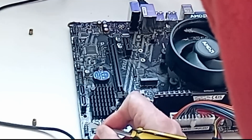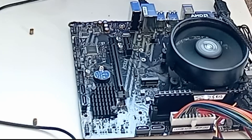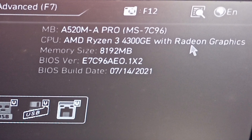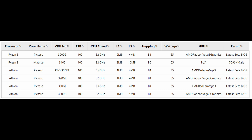To start off, let's check that the MSI A520M A Pro is working fine with its Ryzen 4300GE — yep, all looking good. We can also see that it has a BIOS from the 14th of July 2021, which is only around a year after the A520 chipset was released on August the 18th 2020. Now if you check the CPU support list on the MSI website, we can see that this A520 series chipset may not originally support the Zen Plus CPUs — it looks like support for the 3200G may have been added retrospectively, as it states that it needs the latest beta BIOS.